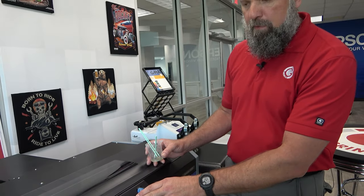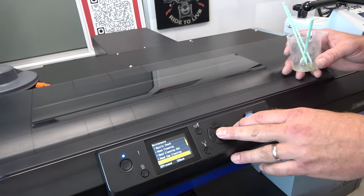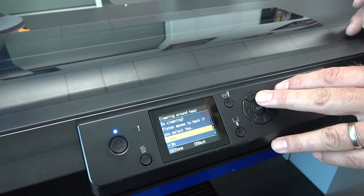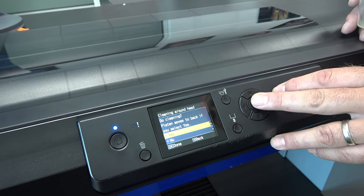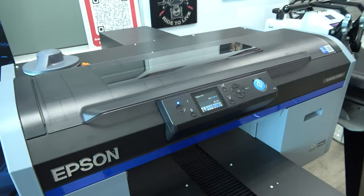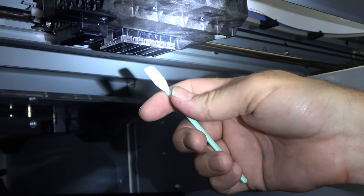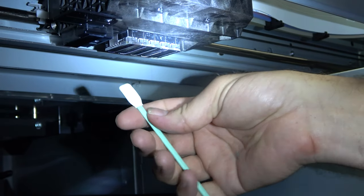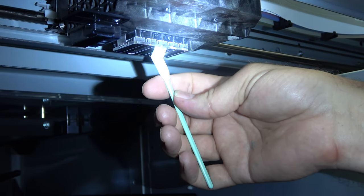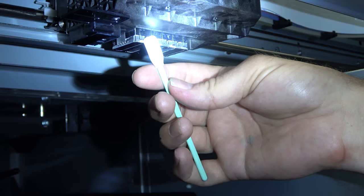The next step is cleaning the print head itself. We're going to go into that maintenance menu and go down to Clean Around the Head. This is a task you may not do every month, but definitely one that could be done periodically — if nothing else, just to inspect around your print head carriage to make sure it's nice and clean. It's going to move the print head carriage to the center of the machine and give me access to the underside. All I'm going to do is clean the overspray around my print head. I don't want to go anywhere near the actual print nozzles themselves — just cleaning off any excess oversprayed ink that might have accumulated around my print heads. You do want to periodically check this area to make sure it's clean and not causing any print resolution issues.